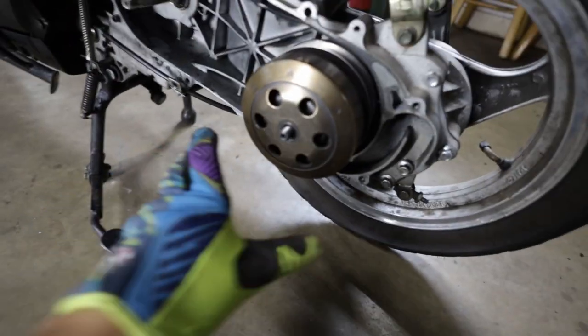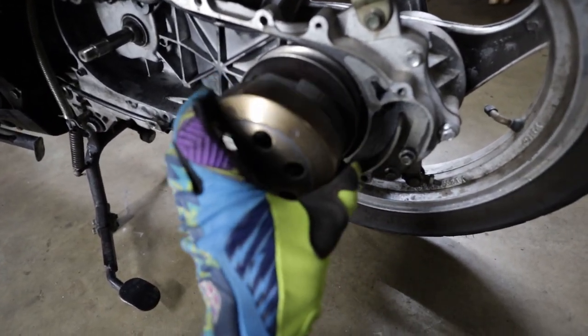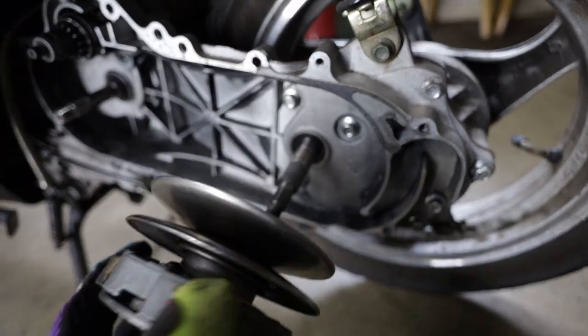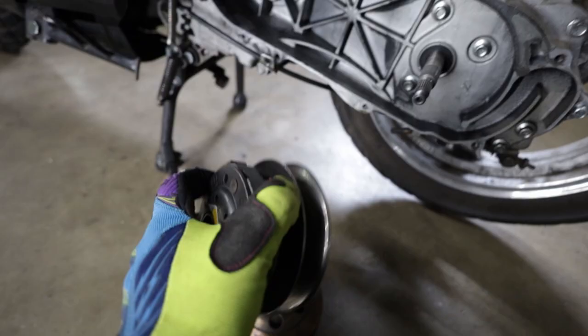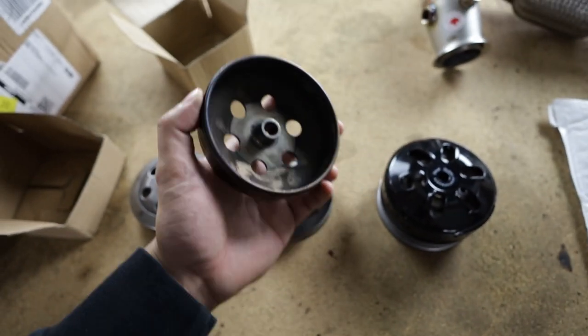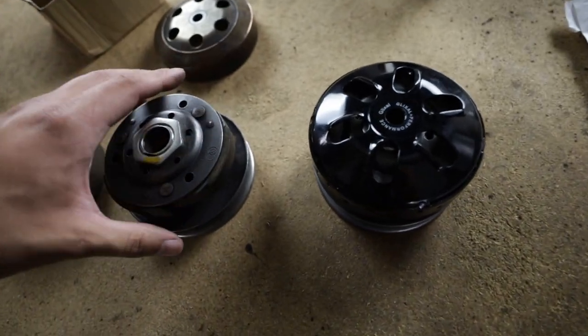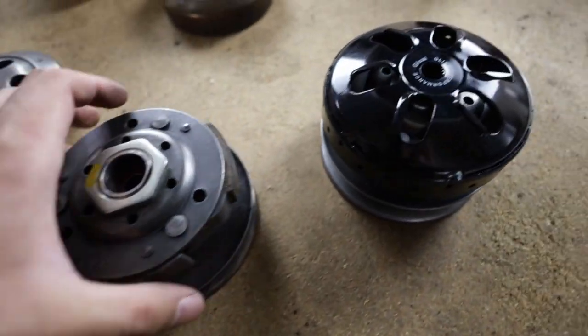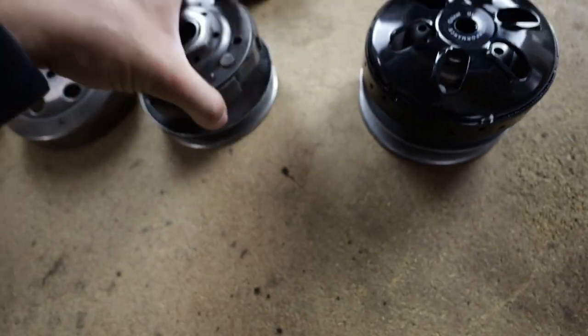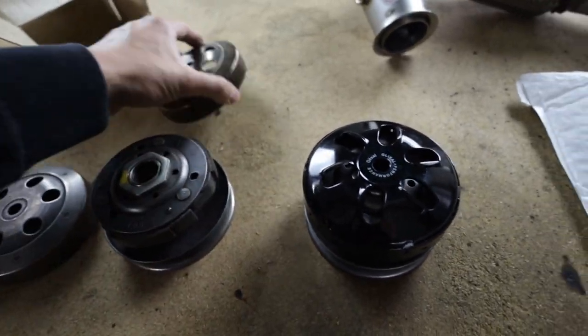Don't lose the nuts. This will come off in two pieces right away. So here's the clutch bell — looks like the other one. Slides right off. You don't have to do anything. It looks okay, it's just dirty. It's got a bunch of dust in it from the pads being worn down. This could be a good backup in the future if we ever needed it. It'll get the scooter moving. We know it actually works. We're going to keep this just as a backup.